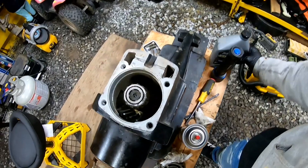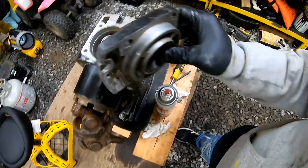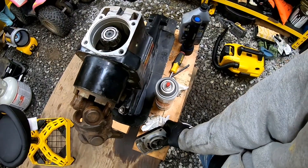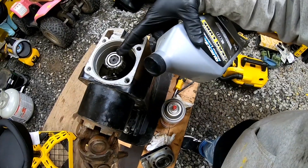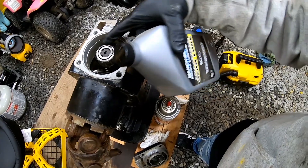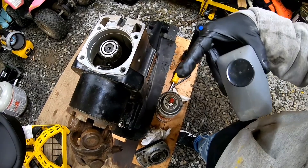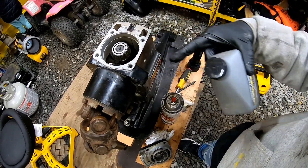That's all cleaned up in there, all through here where it's going to seal. We cleaned up all around that. Now we're going to put a little bit of gear lube just up and around here where we just busted off some of that rust and cleaned it off, just so it's on top here and soaking on it. It'll flow through once you get this thing going, but this might sit for a little bit so I just want to get some up there.